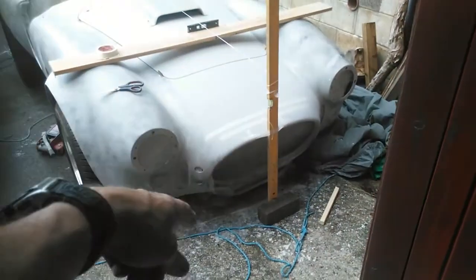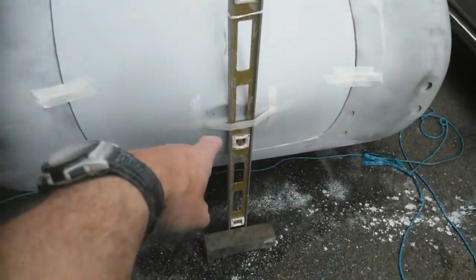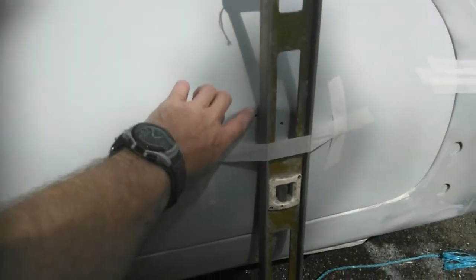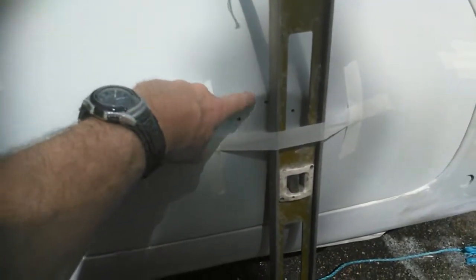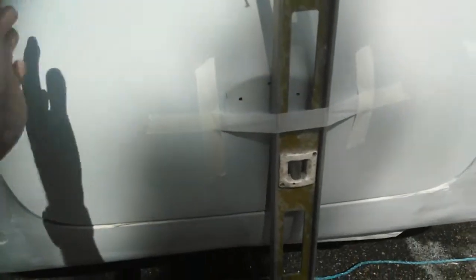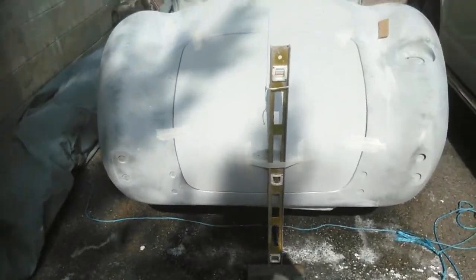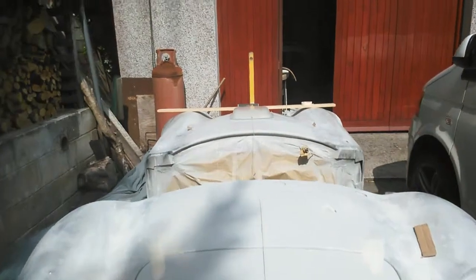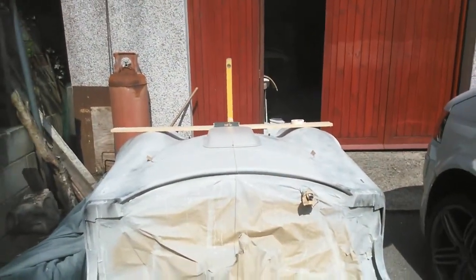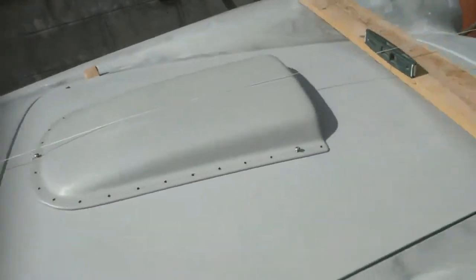The jack is slightly leaking, which is a bit of a nuisance. I've put a vertical reference that's equal distance across the headlamps, and I've already worked out that it's pretty equal around the front radiator. I've got the same thing going on at the back - the spirit level is in the middle of the shape for the rear light, so the lines will be equal either side.